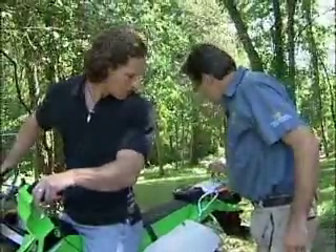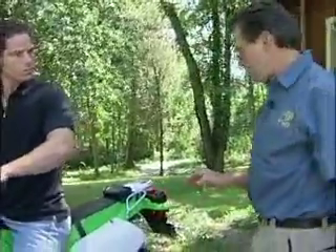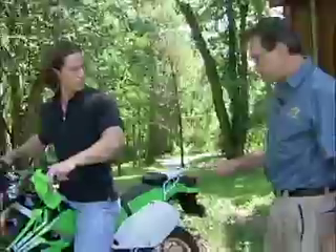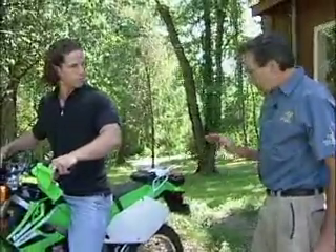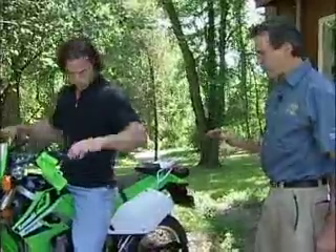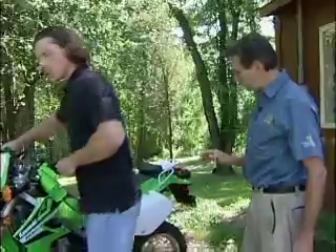So it's a difference of 90 millimeters. With about 12 inches of travel we want about 4 inches of sag. This bike may have slightly less than 4 inches of sag, but what we need to do now is go ahead and loosen that spring up. For our starting point we want to start with about 100 millimeters — that's pretty much standard stuff.